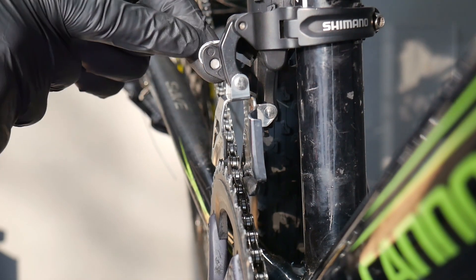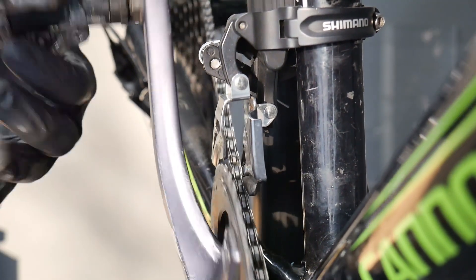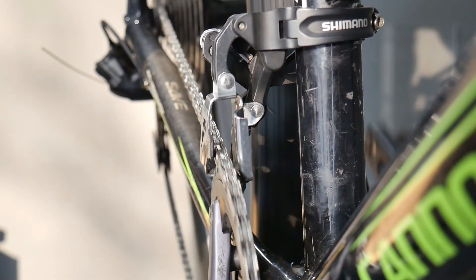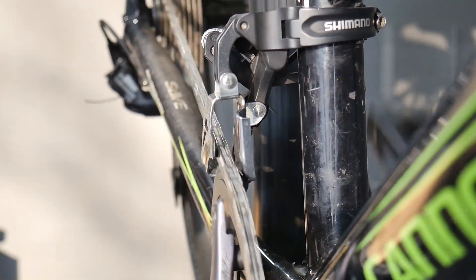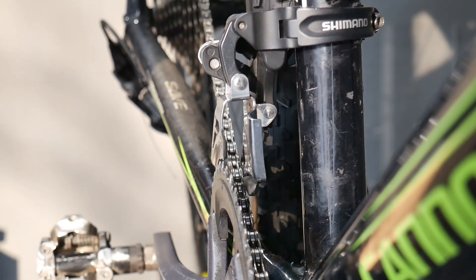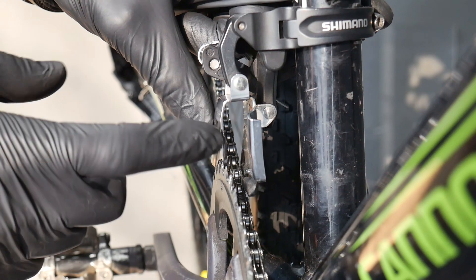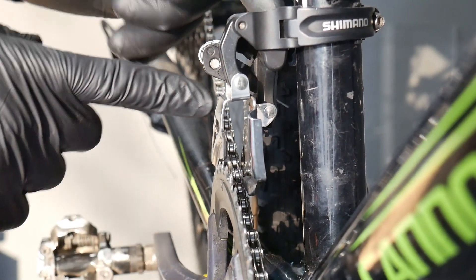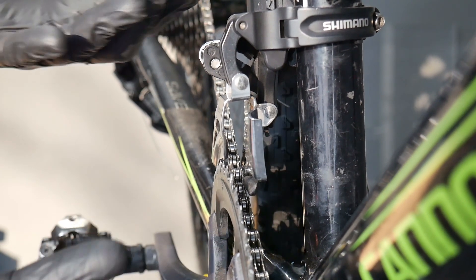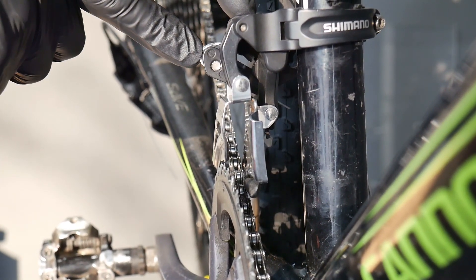It seems like I've solved 50% of the problem because now I can see that the front derailleur has a larger range of motion, but there is still some rubbing — slightly here and badly here. The limiting screws are correct, so it's all done as it's supposed to be. I'm able to move the derailleur even further inwards or outwards. If I release the cable tension it will go further, so the limiting screws will allow for that. The cable tension cannot be different now. The limiting screws are okay, the mounting of the cable is okay, but the problem still isn't solved.